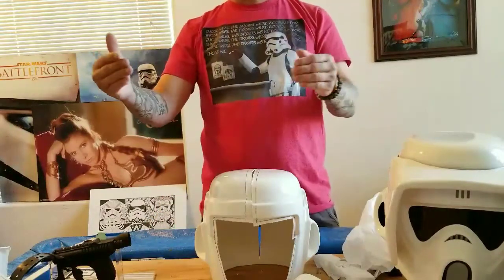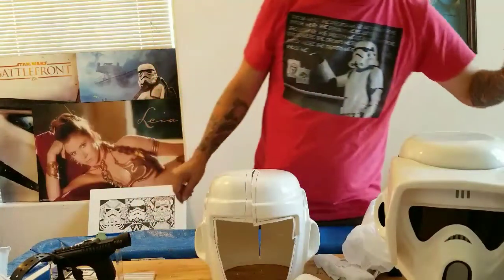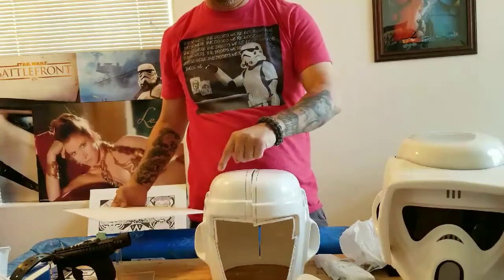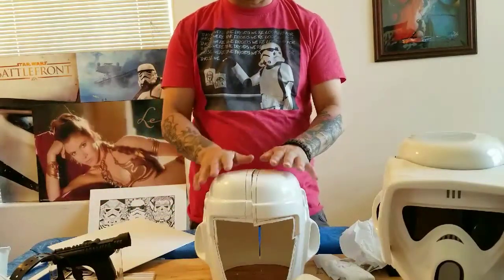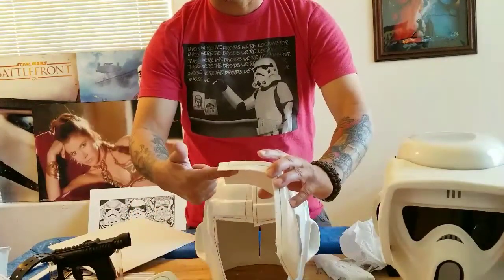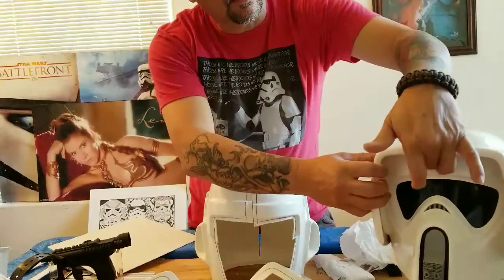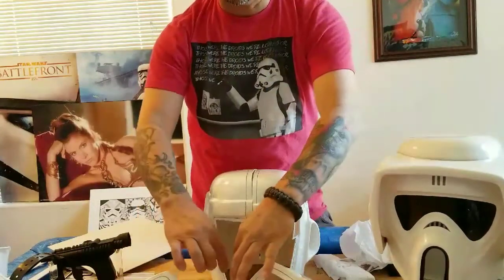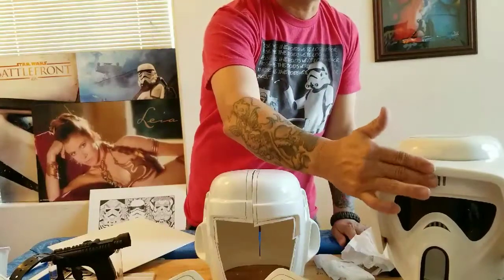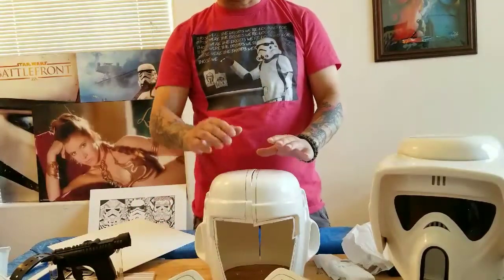All right, so in my next video, I'll show you once I sand all these down, and then kind of mock them up. And then this plastic piece right here, you'll basically cut a circle, and that'll help glue this half to the other half. And then this one, I'm gonna have to figure out a way to glue these two together, or I'm gonna put one underneath, because this kind of comes down enough. You look at here, it comes down enough to where you can glue a small piece right here on this one, and then it'll help glue those two together. And then obviously ABS paste it, then sand it, bondo it, sand it, paint it, and you won't even see the mark on this side. And then this one, just ABS paste all the way down and sand it.